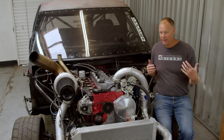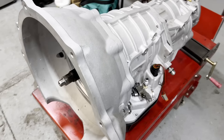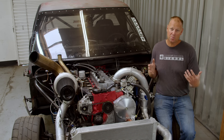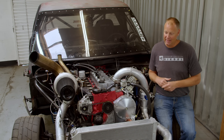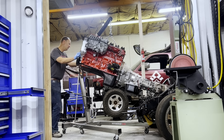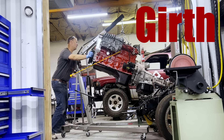For the transmission in the Cummins cart, we're using a new experimental unit. This is an SFI-rated case, a bolt-on SFI-rated bell housing, a heavy-duty overdrive, and it's pretty sweet. We've been in contact quite a bit with the manufacturer - this is not even the final version yet, we're still going to make a few more changes with them. Right now it's great because I don't have to run that flex plate shield or blanket. The way we put this Cummins cart together, I can put the transmission, transfer case, and engine all bolted together as one unit into the truck. It's a massive thing hanging off the end of your cherry picker, but it makes it pretty slick and getting it in place is actually pretty easy.